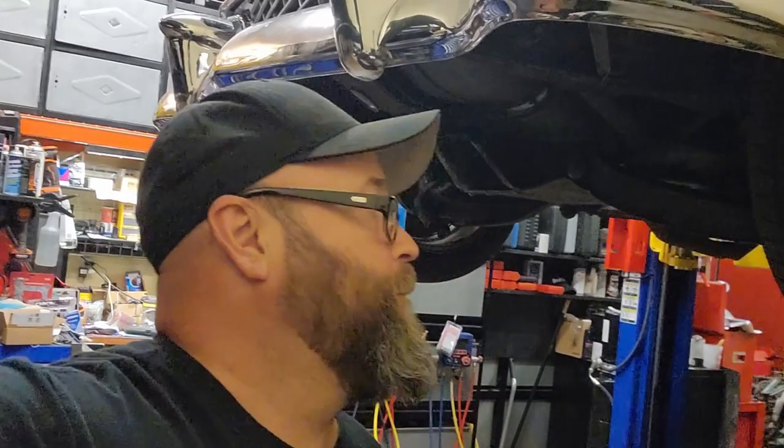you know what, I'm not gonna ruin these tires, and I gotta make sure these tie rods are all back in properly. I know I tightened them down, but just the wheel, this wheel especially, felt a little wobbly, and I was only going 2 miles an hour. You turn the wheel and you could just feel it do a little shimmy shake. So I thought, well, my alignment's probably out of whack, so I just real quick laid down and did a quick measurement, and the one wheel was about an inch out after everything settled and I moved. So I cranked those back in, and seems like I got my alignment dialed back in pretty good.